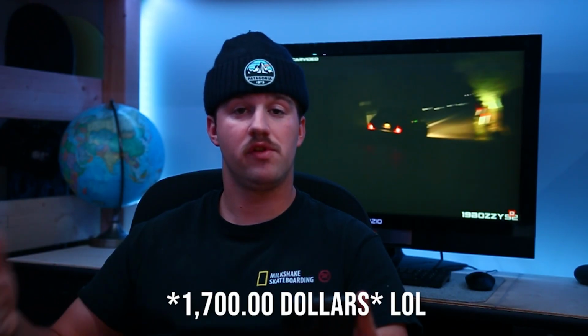Now, what can we look at numbers-wise, price and horsepower? Well, the hybrid turbo from Whoosh is around $1,700 all in. I believe that includes your wastegate actuator and also your diverter valve. Again, direct bolt-in fit right from the website. From a 91 tune, you max at 255 horsepower. Then you take it up to the 93 tune, and the max horsepower you'll be looking at is around 275 horsepower. And then on an ethanol tune, you'll max out around 300 horsepower, somewhere around there, with all the supporting mods for your hybrid turbo.